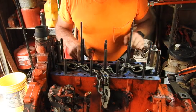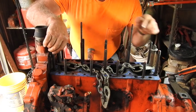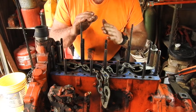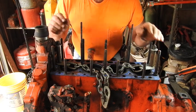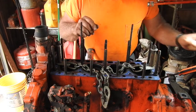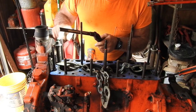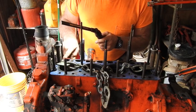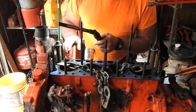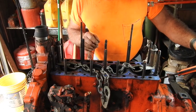If you use these guys or any kind of them, whenever you put that plate onto your studs, don't hook it up to the top of your stud bolts, because you're going to be lifting essentially from two studs. When you lift up from here, the weight of that motor is going to be pulling in and it's going to want to bend your studs inward — you don't want to be replacing studs. So what I like to do is take a gas pipe and extend it all the way down over top of that stud and put some retaining washers and a retaining nut on top, so all the weight is transferred all the way down at the very base of the stud, right above the top of the block. It has less of a tendency to cause that to bend outward. It minimizes the chances of that happening.